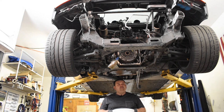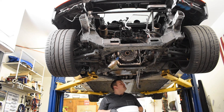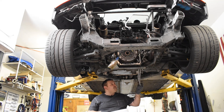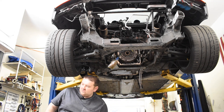The whole system probably takes like seven or eight gallons of coolant, and it's a super pain to pull it all out, suck the system down, and gravity feed coolant back in. We'll do it if we need to at the end, but that can be done at any time. Right now we're just trying to get this motor out along with the wiring harnesses and all that, so we can proceed.